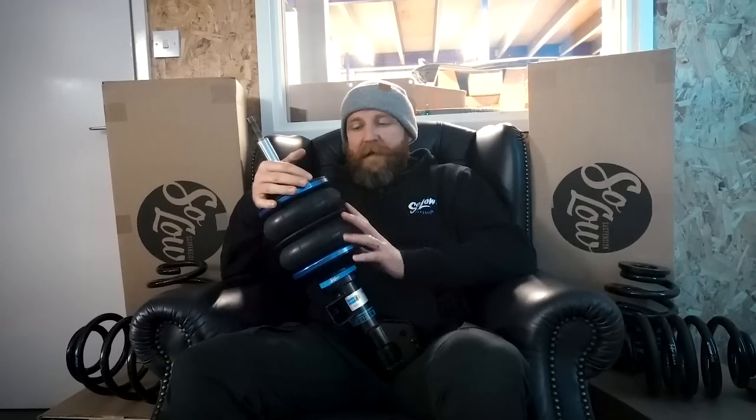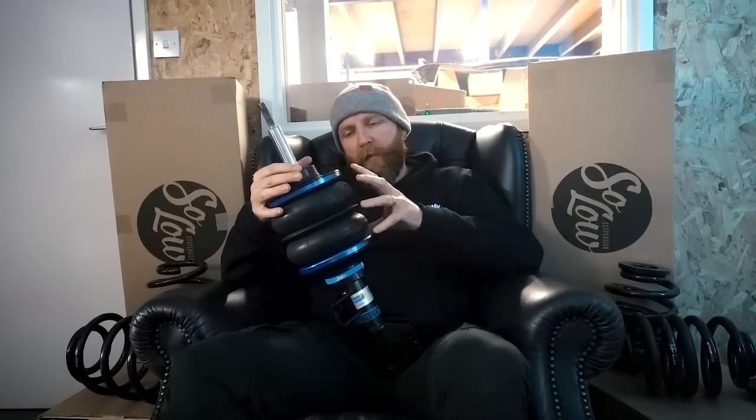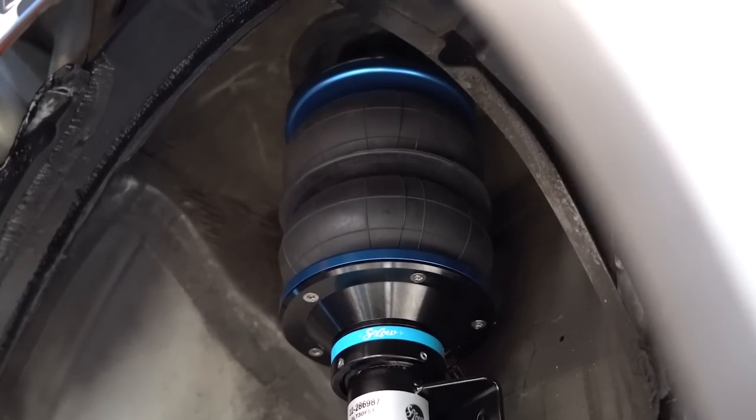With the correct rear damper measurements in place, we set about making a bag kit and the bag plates for the front and rear. First port of call was to speak to Heiss, who sent us the first prototype of his bag kit. The concept bag is quite a thick, dense rubber. The bag we're using is a lot softer and a bit thinner, so it's more manageable. We're also using a smaller front bag than what you see on the market currently, partly because the other bag is probably too big and gives issues with wheel clearances.